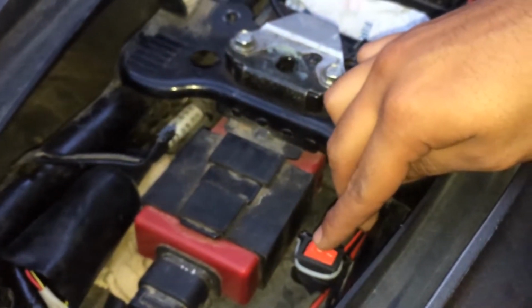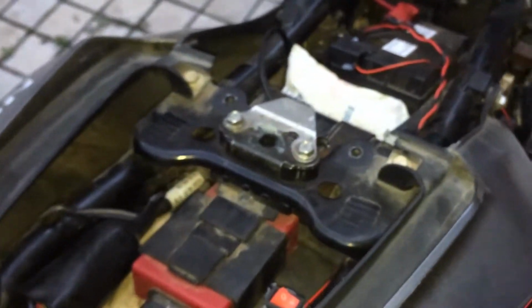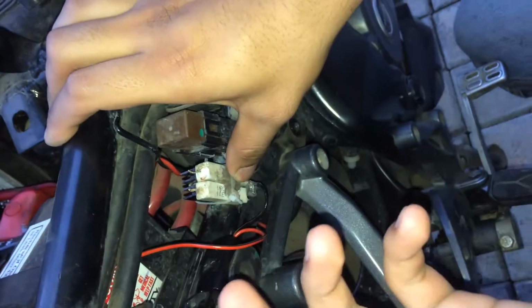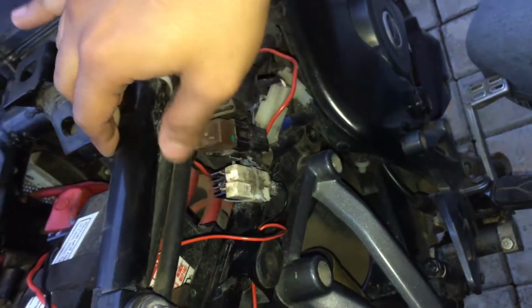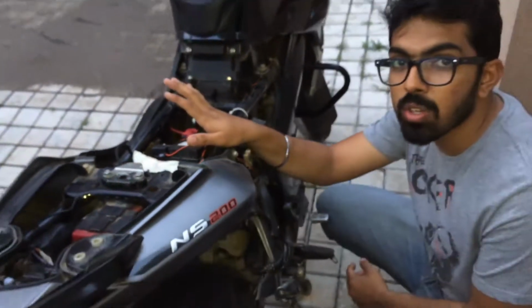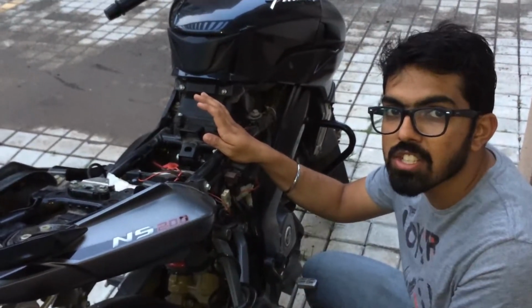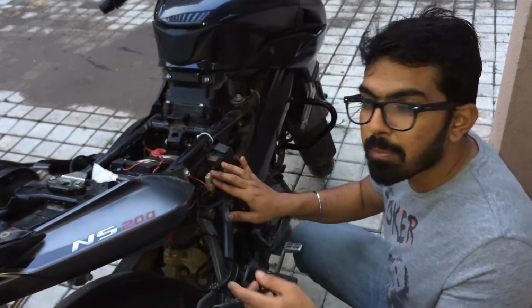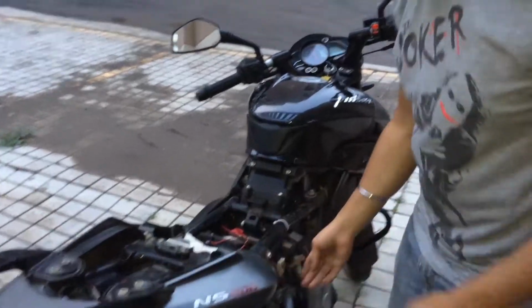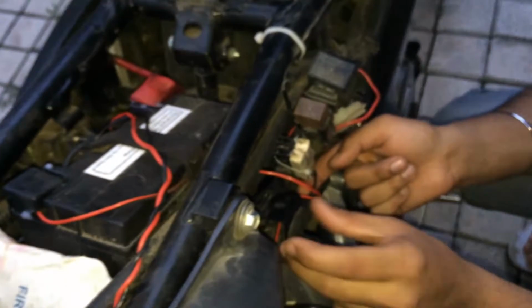This switch I have installed to eliminate one of the problems, that is, when you install these resistors over here and use the indicator for quite a long time, these tend to get hot, because I have to install the highway flasher afterwards. So I have connected the ground to the switch. When I'll be using the highway flasher, I will disconnect these resistors and just directly use the highway flasher. That is it. You can also bypass the whole switch circuit. You can directly connect the negative terminal to the battery side. It will solve your problem.